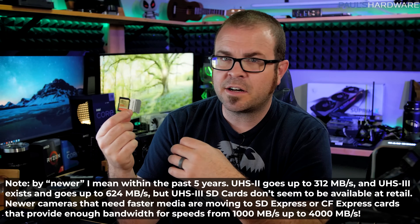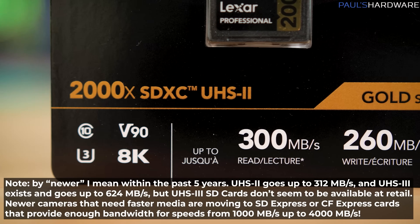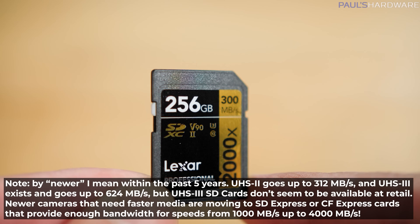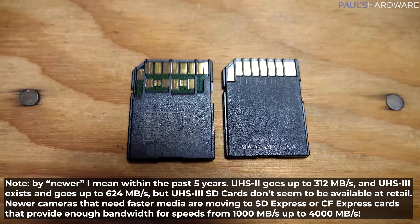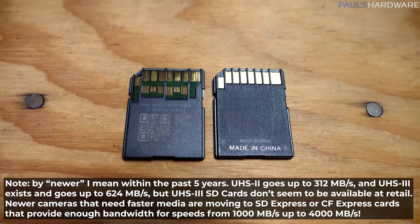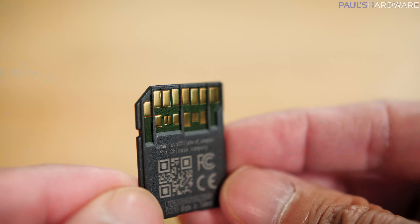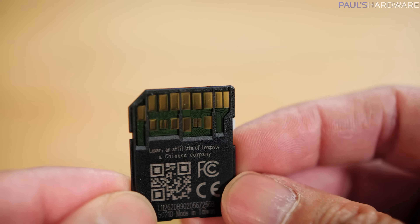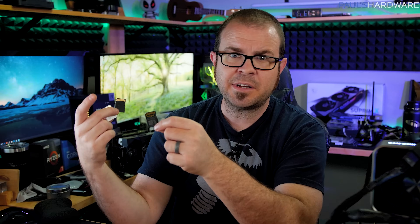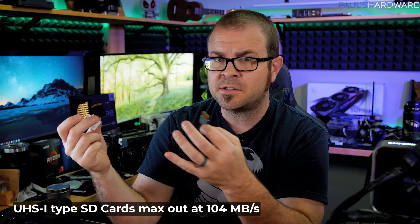There is a newer standard for SD cards rated for higher capacities and higher transfer speeds: UHS-II, or Ultra High Speed 2. There is actually a physical difference on the back of the cards — the little gold contacts. UHS-II cards have an additional eight contact points back there. I'll post an article in the video description if you want to read about the technical differences. By modifying the standard, they've allowed a couple things to happen. One is that these are still backwards compatible with existing SD card readers, though you'll be limited to the same speeds as older non-UHS-II cards.